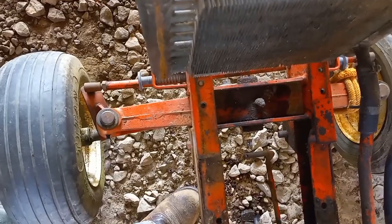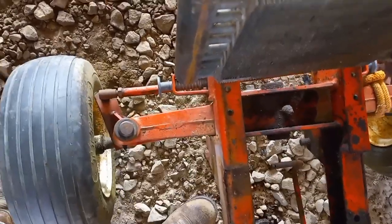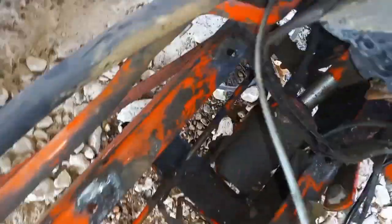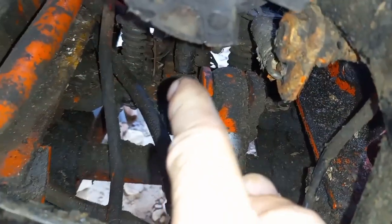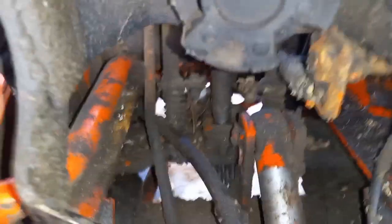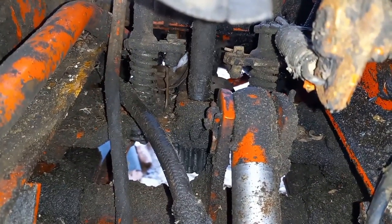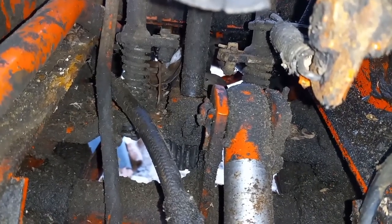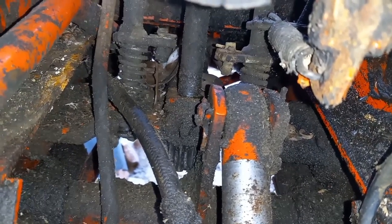If you've got a snowplow on, and the engine and hood and all that weight on the front end, with the snowplow up in the air and you're trying to turn — the force required means you first have to lift the machine before you get any responsiveness from the wheels. That force requires a tremendous amount into this rod and into that rod, through this little gearbox, straight down to the steering shaft and gear on the end with a bushing. There's a grease fitting but you can't get to it. You don't even know it's there. Look at the amount of slop.